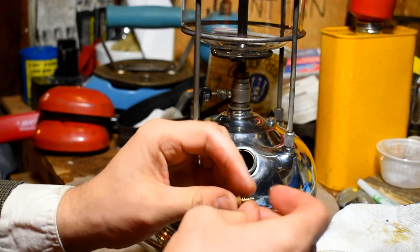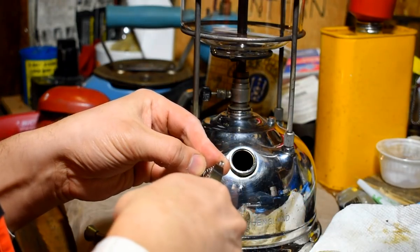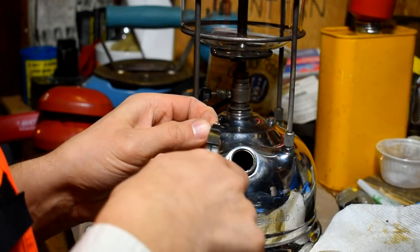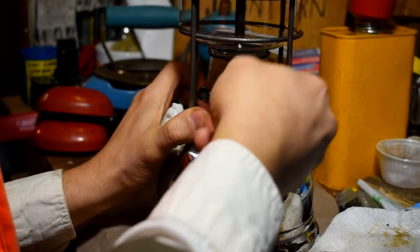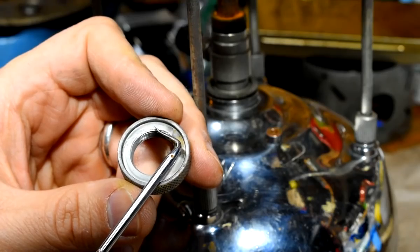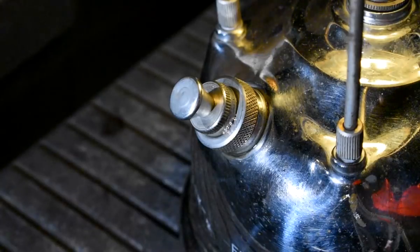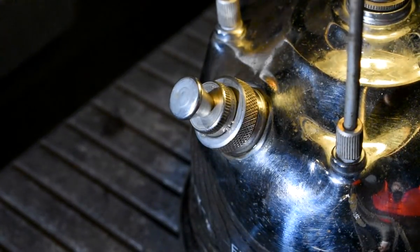The pump is leaking because of that bad spring I mentioned earlier. I'll replace it with one scavenged from a clicker pen — the spring is too long so I'll cut it down. If the spring is too strong, the NRV will restrict air and not work. It's right when the pump tube stays dry but you can easily pump air into the fount. A working NRV makes a popping noise. Later, I discovered a burr around the inside edge of the lip that holds the pump tube seal — there was a consistent leak that went away after I removed the burr. A spray bottle of soapy water was a big help in finding that leak.